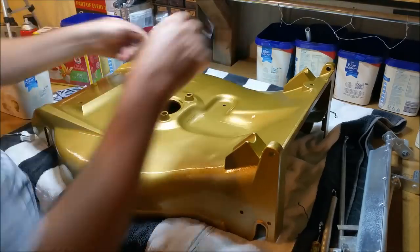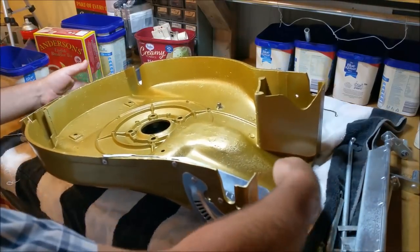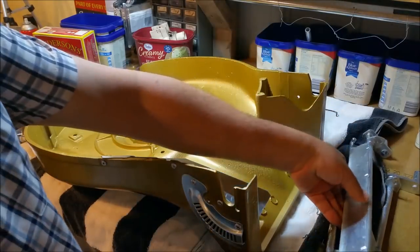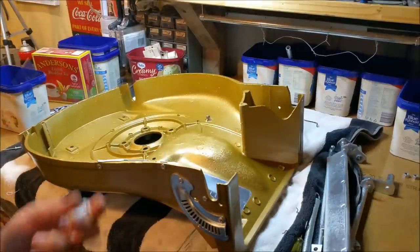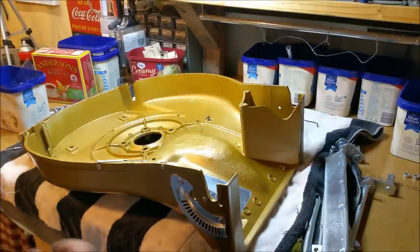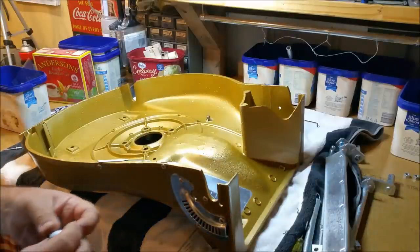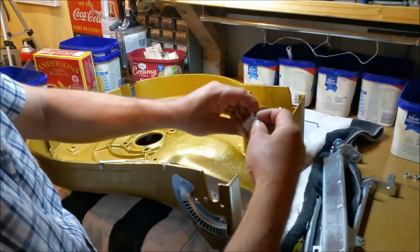So we've got some of the fittings in. Time to stick some axles in. I'm just going to turn it around and start fiddling around with that. This is the best of the rear axles that I have. The bushes that came out of these weren't too bad, but I ended up getting new ones which I've cut down — these are great brand aftermarket. I'm just going to apply a little bit of grease to the axle, wipe it off, and stick these in. I've sort of measured them and cut them to size. Of course, we'll put some new clips on.